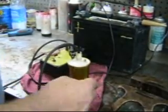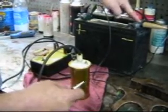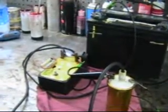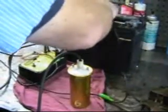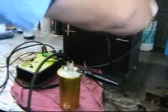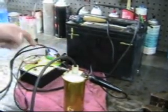Here we have the setup with the coil, and this is set up as though it were a negative earth car, because this takes the place of our distributor. Our distributor is grounded to the negative side of the coil, and the distributor — which would be the white with black lead, normally in your car — is hooked to the negative side of the coil. And when we hook up the positive side, in other words we complete the circuit, we get a nice handsome spark off our ignition coil. Now let's say the car is hooked up positive earth. In the positive earth system, ground is positive. We hook our distributor to the positive side of the coil, because that's the ground side of the coil. The positive side of the coil is the ground side, and our hot side then becomes the negative, and we still get our nice handsome spark.